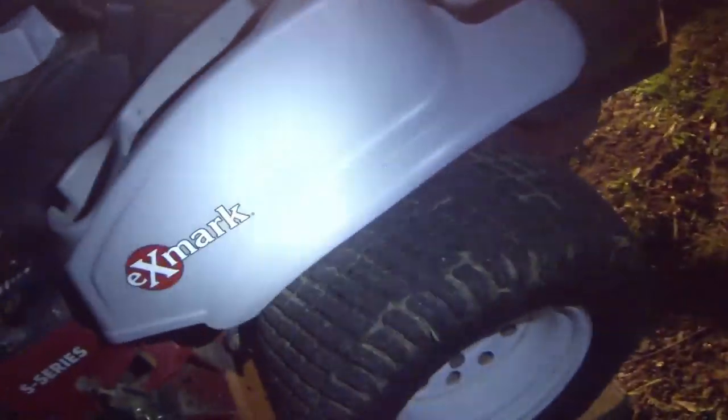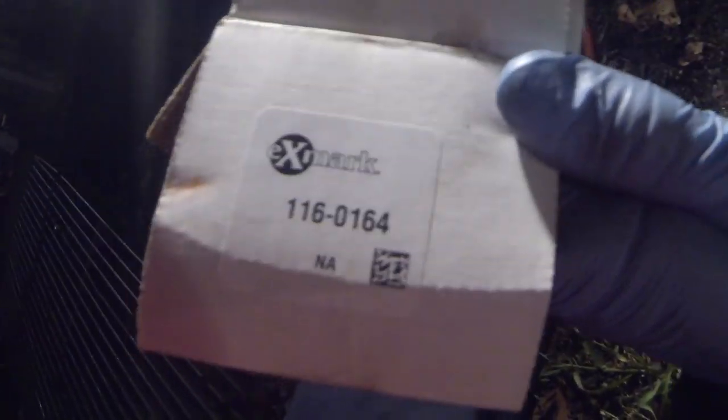I've put some bricks in front of the front casters to hold it in place, and I've got it on a jack resting on blocks with a little support still from the jack so it's safe to get under. I'm going to climb under and pull the filters out. Here's your hydraulic oil filter — I wanted to show y'all the part number. The filter goes in this way, and on the back side this is a five-eighths head, which is what we'll look for underneath the mower.